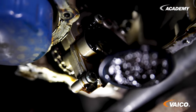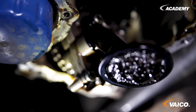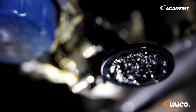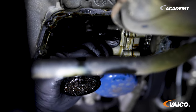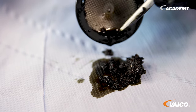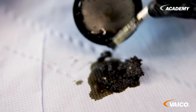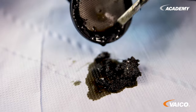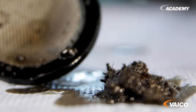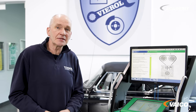As we suspected, we see a completely contaminated and stuffed oil sieve. During idling or cold starts, not enough fluid comes through the strainer to supply the engine sufficiently. You can see the particles — these are detachments from the timing belt that have settled through the oil circuit up to here in front of the sieve, so not enough fluid can get through. With this type of damage, we recommend replacing the oil pump, as it can be damaged by insufficient lubrication.